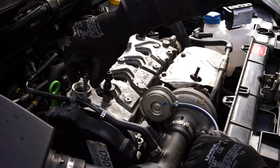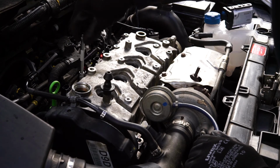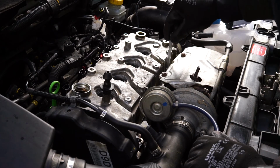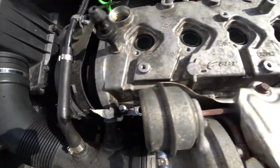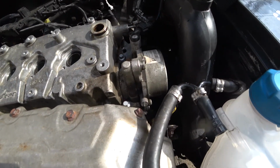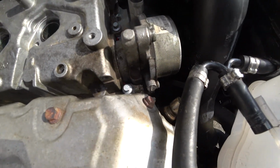And just hand tighten them. Don't use any torque, because we are going to let the RTV sit, not completely tightened, for about 10 minutes, and then we're going to use the right torque spec. So now we've let them sit for 10 minutes, so the RTV is sealed, and now we can use torque to seal it properly.